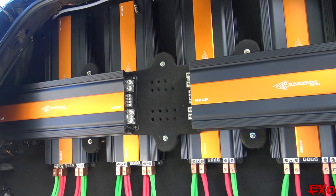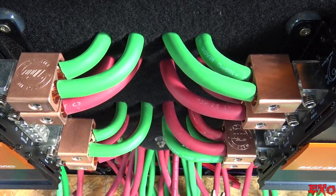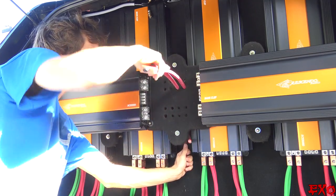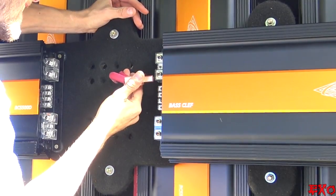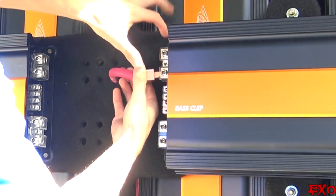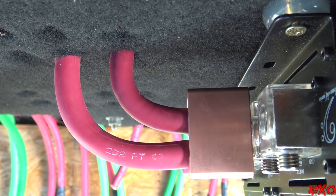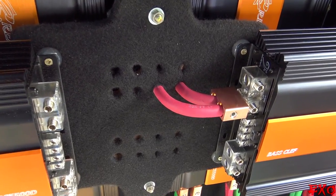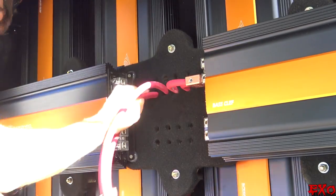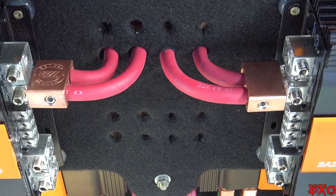When it came to our last two amplifiers, things got a little tricky. The leads fit through the amp rack just fine, but when we started adding all 16 wires it became quite the tight fit. To help group the bunches, we started from the top and worked our way down. Because welding cable isn't the most flexible stuff, we really needed to help bend the copper into place — taking particular care when plumbing everything through. Then it was just repeating this process for the remaining 14 connections, grooving out and getting it done.